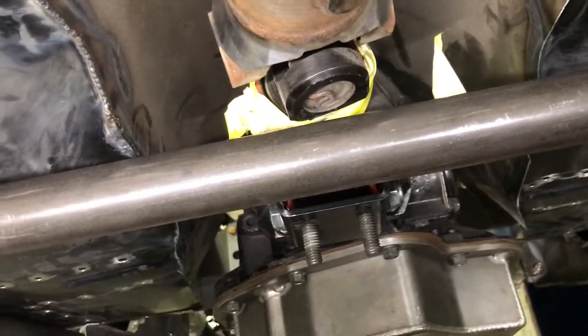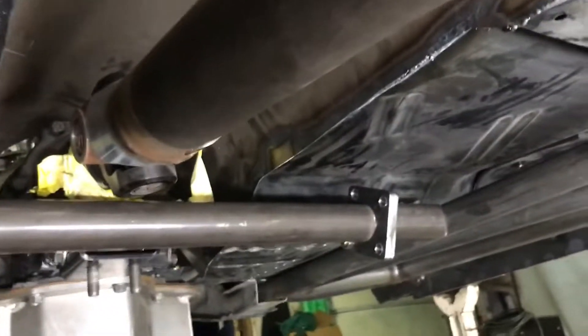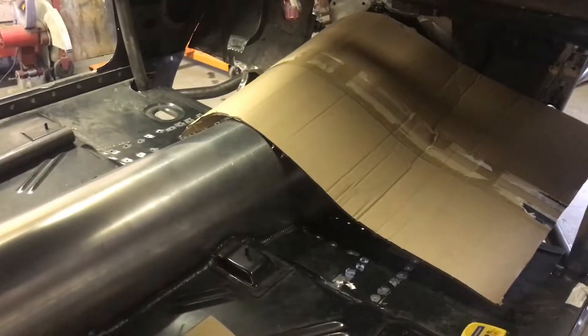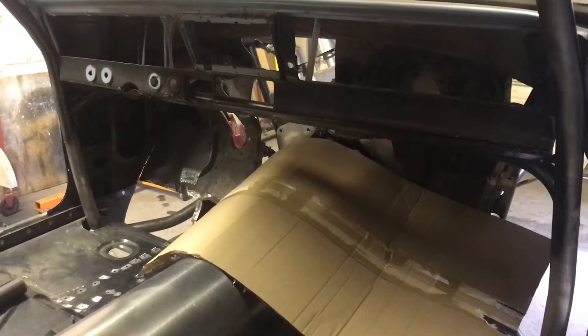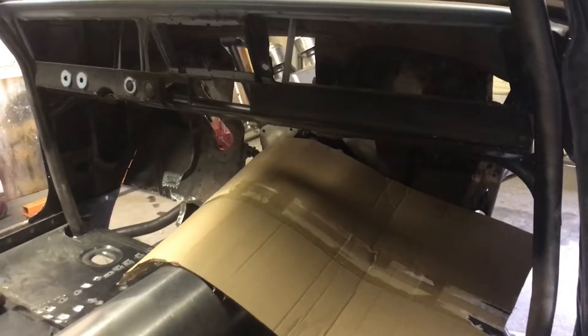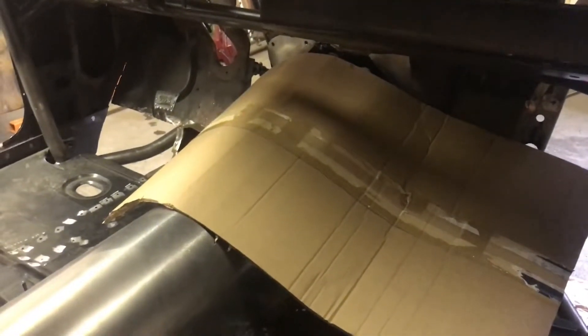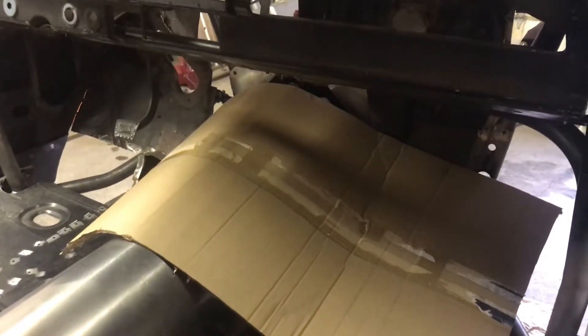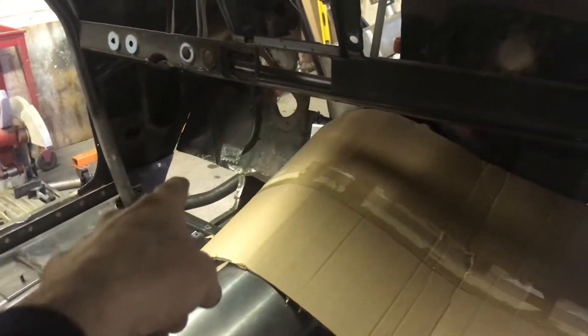Now I'll see about putting this exit in real quick. I still gotta grind all this stuff off — I'll take the driveshaft out and grind all this off once I make this crossmember. All right, today I'm gonna go pick up the hardware for that. When you're doing stuff like this, cardboard becomes your best friend — cardboard, poster board. I'm waiting for Johnny to come help. We're gonna set this up, start trimming it back till it fits the way we want in cardboard, lay it out flat, and bring it over to Dutra's to have them cut me a piece. I also got measurements for all the foot boards.